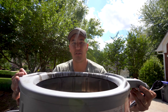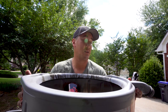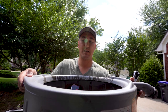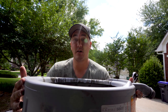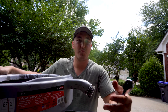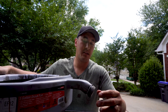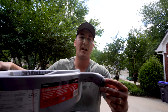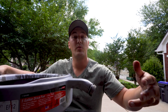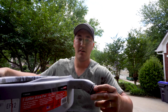For this size of truck — this is a 6.7-liter diesel engine — you need a five-gallon drain pan. You need to have this underneath beforehand because the moment that nut comes off, it's all going to start spewing down into the pan. This also makes it easy to hold everything and keep it from dripping all over the concrete. Afterwards, you can unscrew the cap and drain the engine oil into a recyclable bin. Many auto stores provide the capability for you to bring it in — I actually prefer to bring the old oil in the engine oil containers we're dumping the new oil out of, and bring those over to the store to dump into their recyclable receptacles.